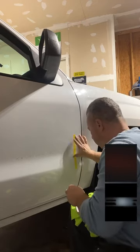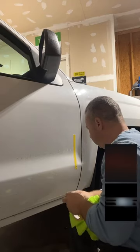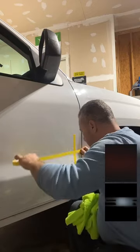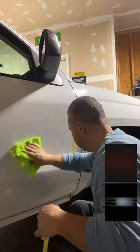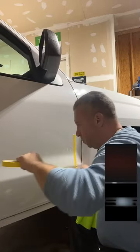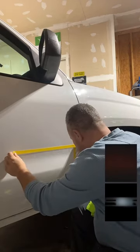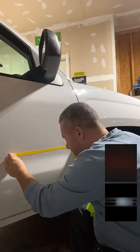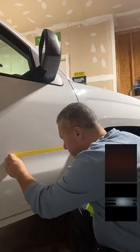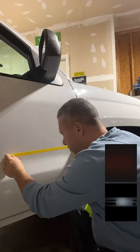That's one of the things that I have done. I used acetone in the place of that. The big trick with acetone is using it with a blue towel on a roll, and making sure that the acetone stays soaking wet. People don't understand that acetone gets a lot hotter as it dries off. The further it goes, the hotter, the more it evaporates off, the more caustic it gets. So the trick is wiping that panel with that rag so wet.